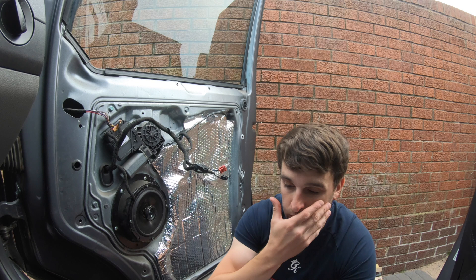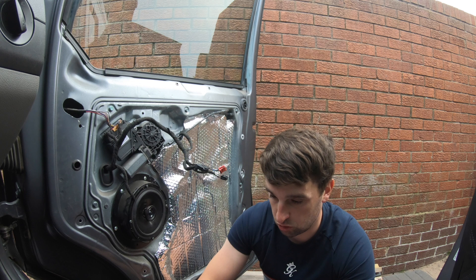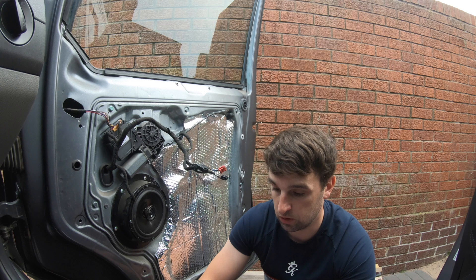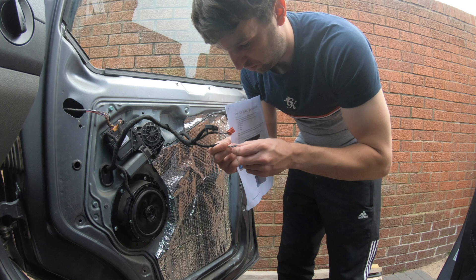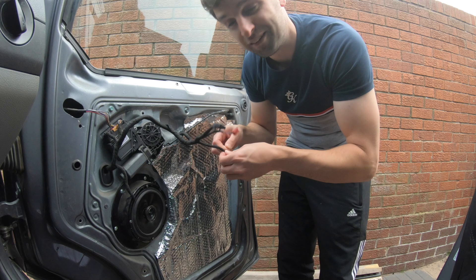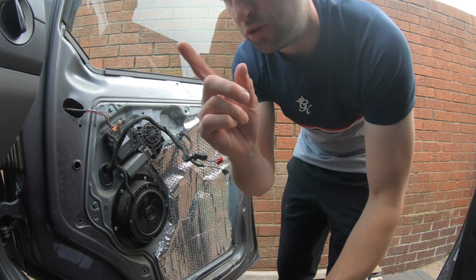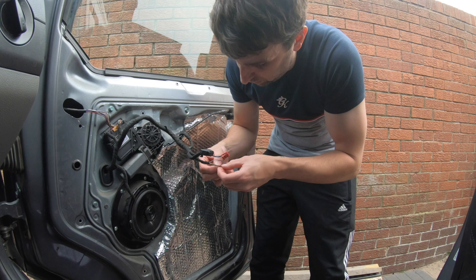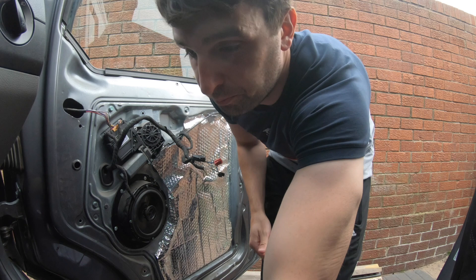Reading the instructions: locate the positive on the VW electrical wiring loom. The positive for the VW is the gray and blue wire off the window switch — gray and blue, confirmed. And the negative is brown. Happy with that. So we'll slide that back — I don't recommend using a blade for that. Gray and blue is the live, and the brown is the earth, so let's separate those.